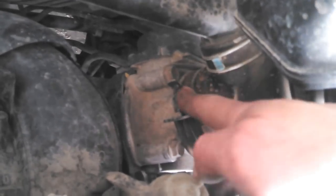What happens is you get buildup in your throttle body, which is right back here — it's this place right down at the base. That's your throttle body, and it gets a carbon buildup. You take and put a plier on these two clips right here and pull that loose.